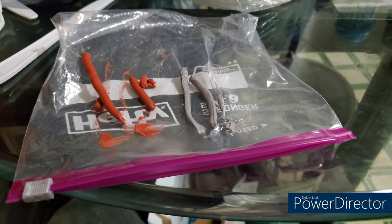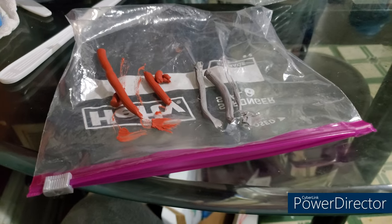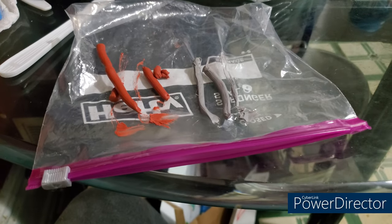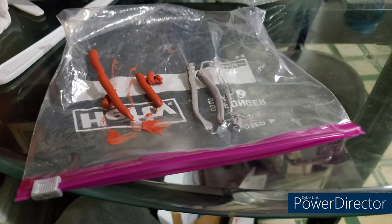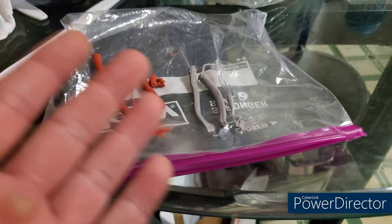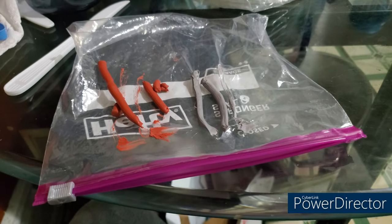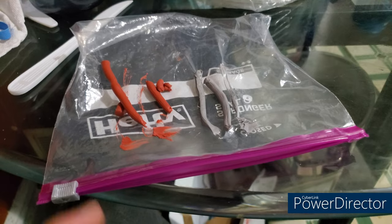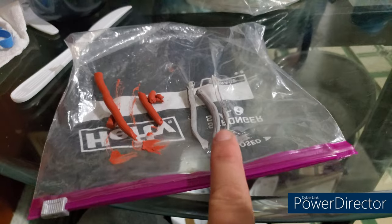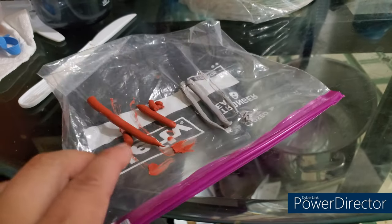What I would recommend if you guys are doing any type of trans case cover, oil pan, valve covers, etc., is to always buy a fresh tube of whichever you'd like to use. Permatex is a great manufacturer — they have all different types of sealants. The FIPG is a good product as well. However, this Permatex has an expiration date stamped on the product, but the FIPG doesn't.